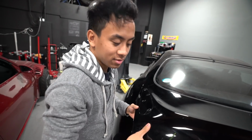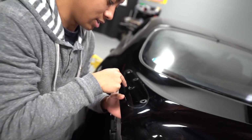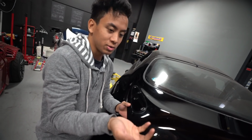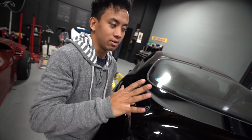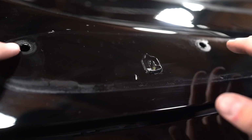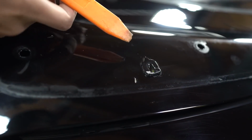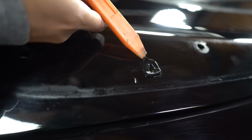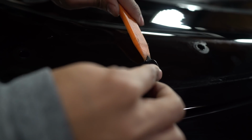Toyota technology, they need a clip to keep it in. And our aftermarket one doesn't have space underneath for that to recess. Also, we had to take the wing apart because the wing wasn't sitting right when it was all together. Beyond having 2 holes for hardware, they have a clip that a peg from the stock spoiler goes into, and that is not allowing our wing to sit flush, so we need to pry that out without trying to tear up paint.